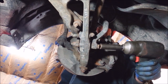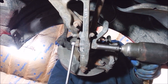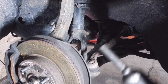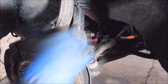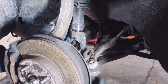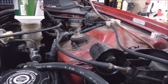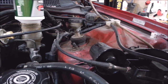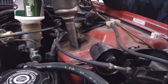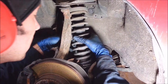For the fronts, get the strut bolt off — both are 17 millimeters. Just like the rear, if they're rusted to hell, good luck. Then get the 14 millimeter pinch bolt off. Sometimes you've got to pound on the strut but it usually just falls right down — just leave it flopping there. Next take off the strut tower bolts. I'm gravity-bleeding my brakes while I'm at it — that's what the bottle is for. Hold on to the strut while you take your last bolt, then squirrel the thing right out.